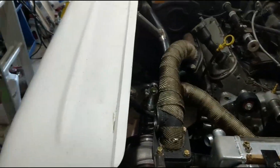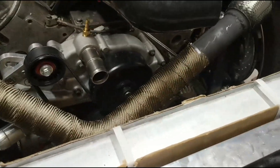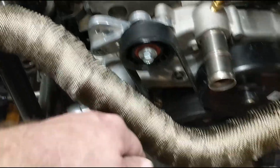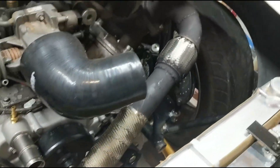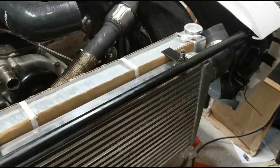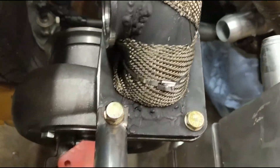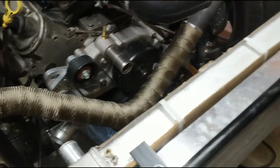Today had been going really well, just hit our first roadblock. Got the radiator mounted and I was kind of worried about this — remember I had to move my hot side because of my accessory drive, and it did come out further. So there's not enough room there for my fans. Going to regroup and come up with plan B. We may try to move all this stuff forward just a smidge, but I really don't want to do that. I don't really see any other choice. Let me do some finagling and see what we can come up with.